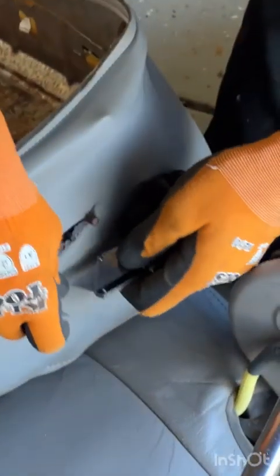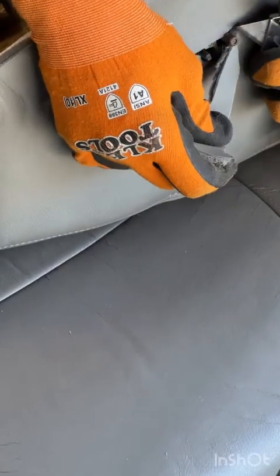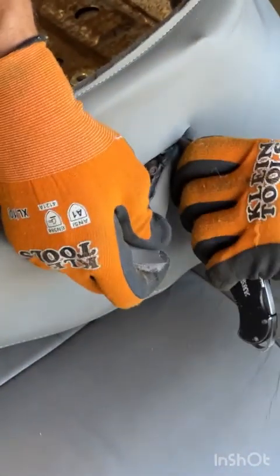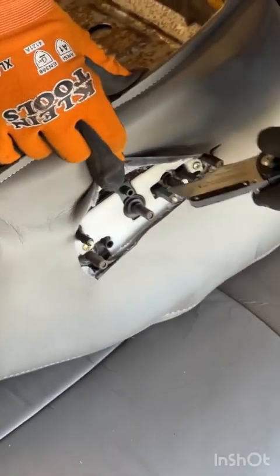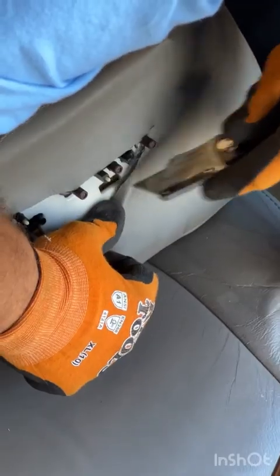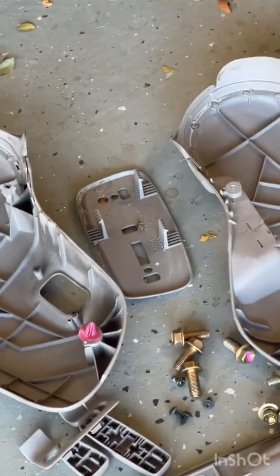Once we have it stretched as tight as we want it, then I'm going to notch out for my little Toyota engineered trim piece, and make sure that we've got our 1, 2, 3 tabs accessible for the sake of popping in the exterior trim piece for our power seat controls.